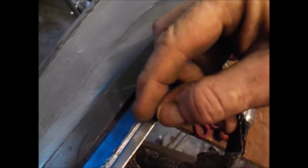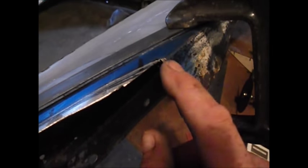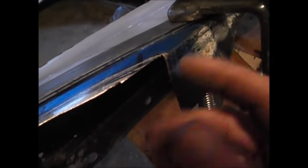If it's away from the panel just a tiny bit, that's okay because you're welding in there anyway. If it's too close, you've got to shave the panel down to get it to fit. Maybe I'm overdoing it, but I want this flange to be nice and straight. I can sand my replacement panel down just a little bit to fit. So I've got a butt weld here. I wanted a flange weld — it was just I had to cut this section out and then a little flange. Screw it, just lop it off. We've got this right here cut for our eyebrow to come back.